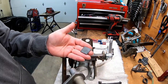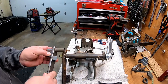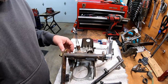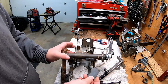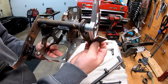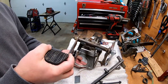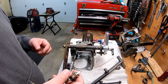I'm going to take this little piece of scrap steel and weld it right here on the pedal. When this is inside the box, this little tab is going to actuate the brake light switch. And I've got another little piece of scrap steel that's going to get welded on right here — that's going to be the clutch pedal stop. That's going to set the outward pedal travel, and having that stop is going to help us utilize a clutch safety switch.